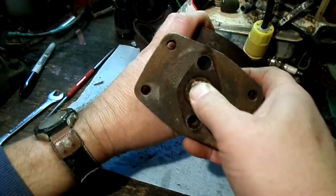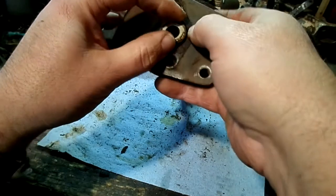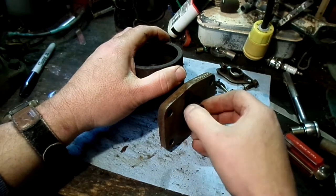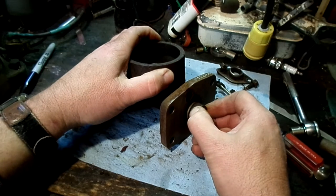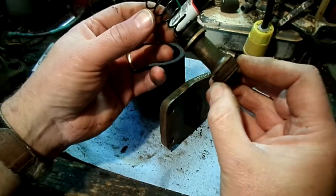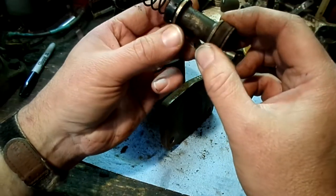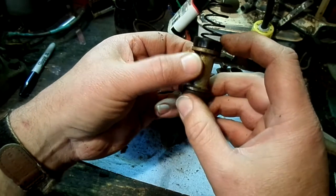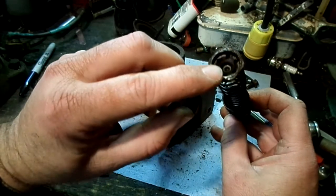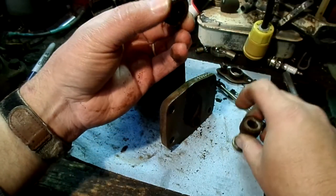That's the piston right there. I'm thinking this rear lip seal is probably what's damaged on this one because I was able to fill the thing up full of brake fluid and get brake pressure, but it just leaked out the rear of the cylinder. You can see the lip seal is so compressed it's not doing its job anymore. The cup seal must still be doing its job because I was getting some brake when I pumped it. That's the check valve and that's the spring — none of these parts actually stay together; it's just stuck because it's gummed up.